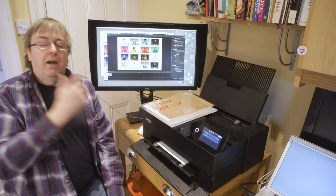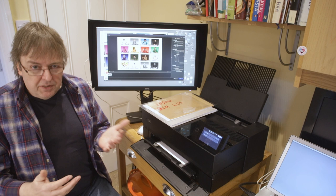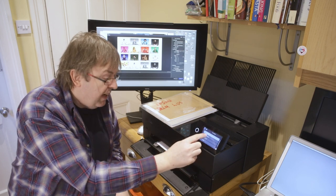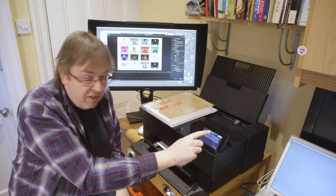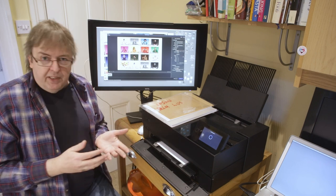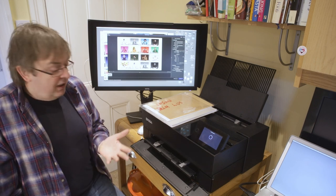I don't have to set the paper type on the printer, but I make a point of doing so — as much as anything to mentally double-check that I've got everything right. It saves wasting paper, which matters to me as I swap papers and printers quite often. So for paper type: it's not premium glossy, let's go to more paper types — it's a photo paper. Notice only photo papers are available here, and it is Premium Luster. Size — it says A3+, but no, it's A4. We've set that: front paper feed, no eject roller glossy, Premium Luster, A4. If I'm printing a stack of these I don't have to enter it every time — the printer will remember the settings.